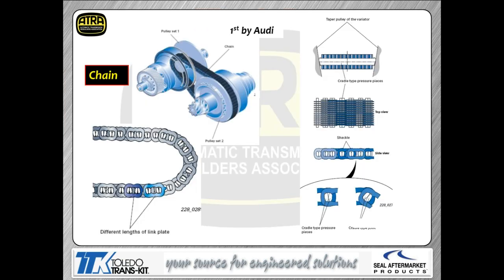Now, as I talked about the chain before, we said there were two different chains that Audi had, a wide one and a narrow one. Make sure, again, that you get the right chain for your application. If you fail to get the right chain, because we've had this happen numerous times, you'll end up with the wrong ratio. So make sure you measure your chain. Even though it's pretty self-explanatory, make sure you check it to make sure you're putting the right chain back in there.